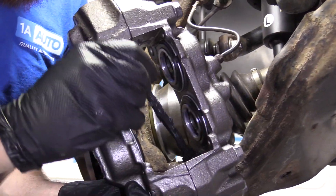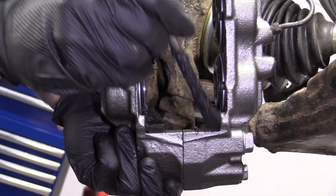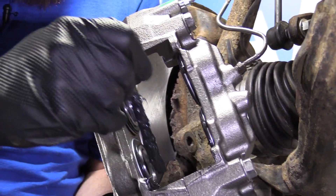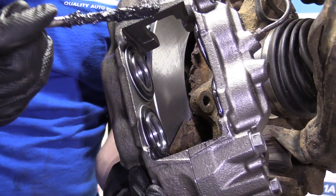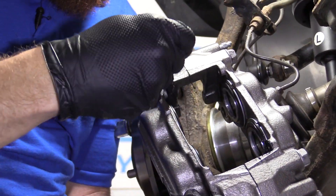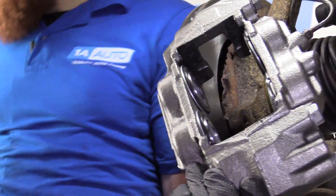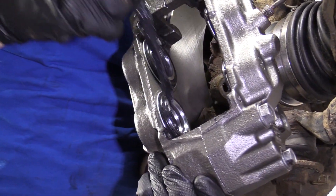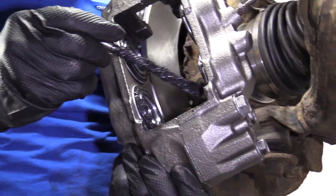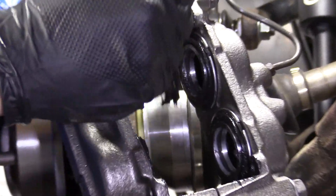It's always a good idea to use a little bit of caliper grease on your caliper. I like to go right along the edge right here — that's where the edges of your pads are going to ride, so you want to make sure that you don't get a lot of moisture accumulation there. You've got the holes where your caliper slider pins go through — that's where your pads slide. Do the same up on top. Now we're just going to do along the pistons — this is going to help with vibration dampening and noise reduction.